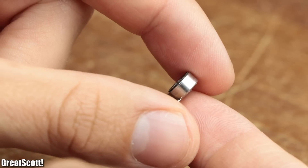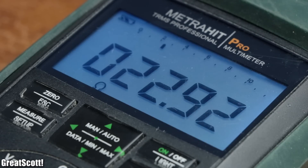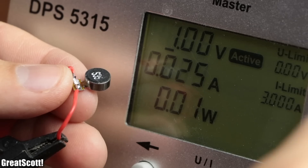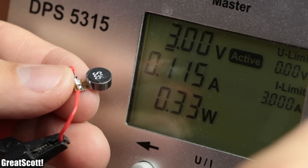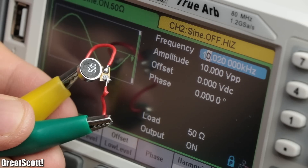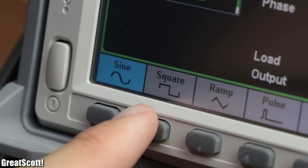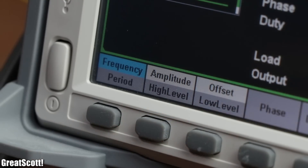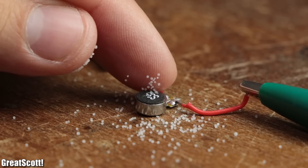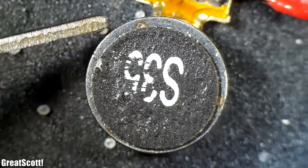The small coin cell component, however, looked interesting. Its resistance of around 23 ohms was easily measurable through its copper pads. Since the component did not react to DC voltage, I hooked it up to a function generator to find out that it also does not serve as a decent speaker. But later I found out that by using a square wave with a frequency of 150 Hertz, the component starts vibrating intensely, which makes it interesting for future projects as a kind of alarm.